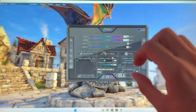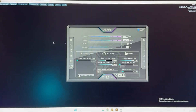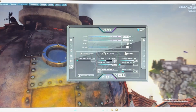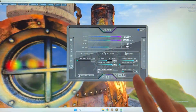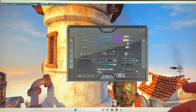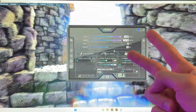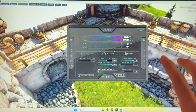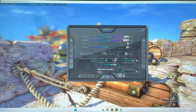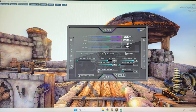For the core clock, here's the method: go up 100 MHz at a time. Start at +300, hit apply, go play games and run some benchmarks and see if it crashes. If it doesn't crash, go up another 100 MHz — so +400 — and test again. Eventually it's going to crash. Once it crashes, go back 50 MHz from the last non-crashing point, not from the crash point. That way you're absolutely sure you won't crash, because it's not worth getting an extra 2% performance if your PC crashes once every three months while playing competitively. On average, most cards can do +400 — and some cards can even do +500 stable, though not this one.